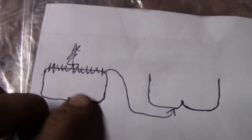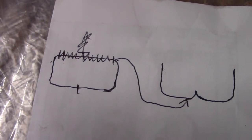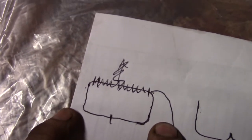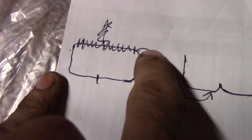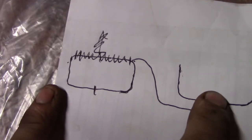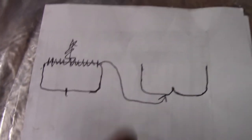What I did — I went to the store and drew a little picture here to explain, because it's been a while and it didn't work out the way I intended. What I was originally going to do was take rectangular tubing, cut here, cut here, take that piece out, shove it up into the frame and weld it. But the inner diameter was not the same — it was close but I couldn't get it exact. I thought I could heat and tweak and shove it up in there — not so much.